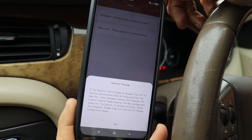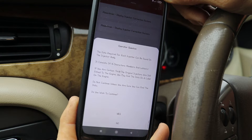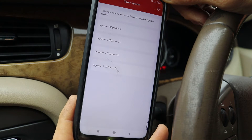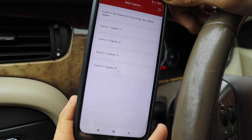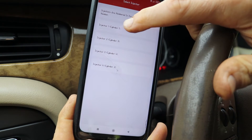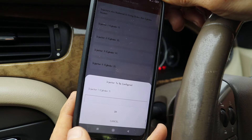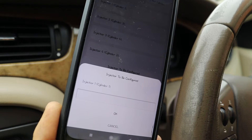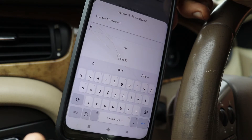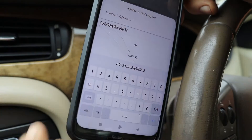So to code the actual injector I'm going to press the top one. A little message comes up with some information — quite useful. Then another dialog box with more information telling you that it's a 16-digit code for the injectors and to make sure you've got that code before you carry on. I can agree to that. Then we've got a list of all the injectors and which cylinder they're in — the cylinder numbers are important here. Mine happens to be cylinder 1 and injector 1. Cylinder 1 is on the pulley side of the engine. So I'll go into cylinder 1, injector 1, click OK, and here's my space where I can put the injector code. The injector codes are often a mixture of numbers and letters — I use capital letters rather than lowercase. Make sure you double-check or triple-check these are correct before you press OK.